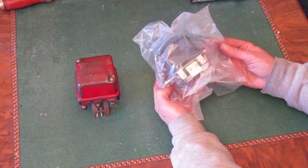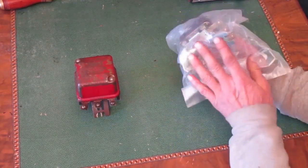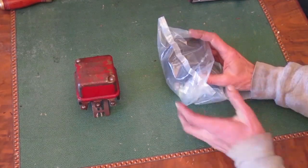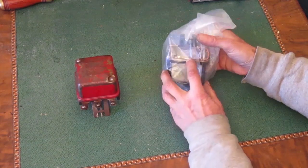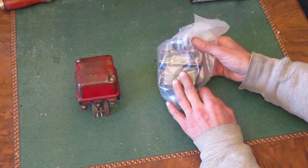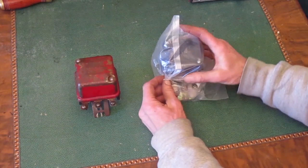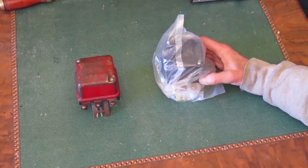There's another style — the only one I have is this new one, still in a sealed bag so I don't want to open it. It still has the curved mounting on the bottom and three terminals on the side, but there's not one on the bottom. This is a three-terminal style. They removed the L terminal, moved the BAT terminal to the left, and moved the generator terminal from underneath to the middle.